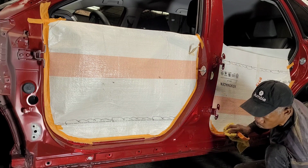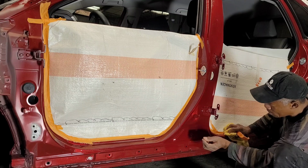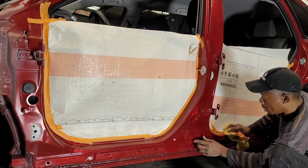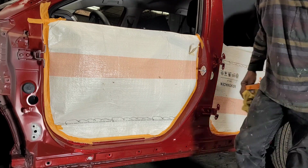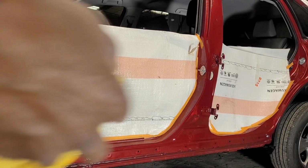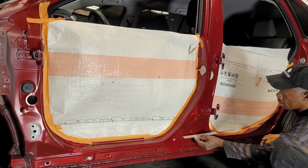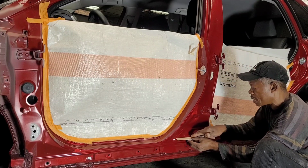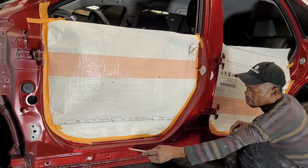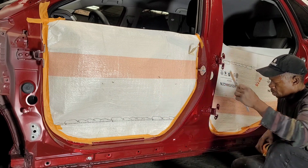Because I would just use a ruler, a stick with a ruler, which has straight lines. So I put it on it, and you will be able to see low areas. I put it on like this. Let me show you. Something like this that's straight, with a straight edge. You put it on, and you can see the area that's low. But I'm gonna start with this issue here and the one on that side. I'll start now and try to pull that out.